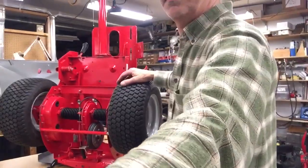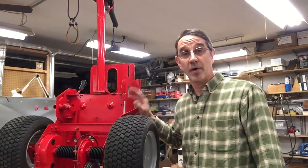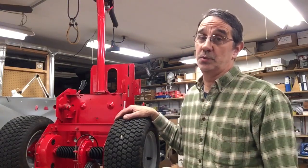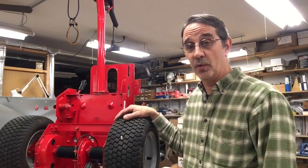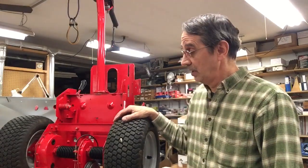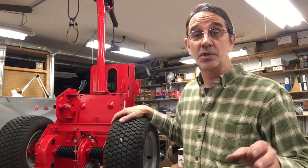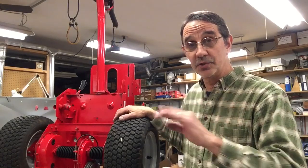In the next video, I'm going to be putting the engine on and doing some wiring. I've had a lot of people get a hold of me about safety switch issues. They're tired of the switches going bad. Can I just take them off and do away with them without causing a problem? Yes, you can. It's not a big deal to get the switches off. Actually, you don't even have to take them off. You just have to remove a couple of wires from a stud and you're done with them.